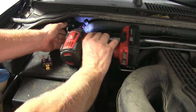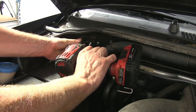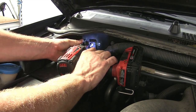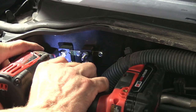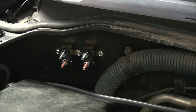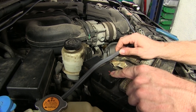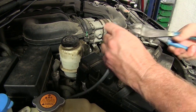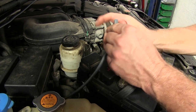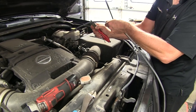To install the screws, we're using a quarter-inch nut driver. We'll just overlap the two mounting tabs and use one screw to hold everything together. With our circuit breakers mounted, now we have a better idea where we're going to run our wires through those and to our battery. We'll go ahead and cut off our excess. Next, we'll take a moment to split the wires apart because we'll go pretty far back and split them.